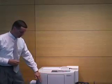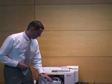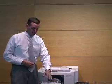The RISO is very well known for its reliability and very few paper jams. However, in the event there is a paper jam, the RISO is very easy to clear. Because of its direct paper path, the paper starts here and exits the machine here. Ninety-five percent of all jams happen in the paper feeding area and are easy to remove. For the other five percent, it may be necessary to release the cylinder, remove it from its holder, and reach in to remove any jam paper under the cylinder. After that, simply close the cylinder back up, hit reset, and you're all set to go.